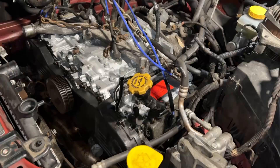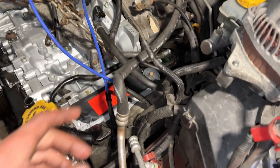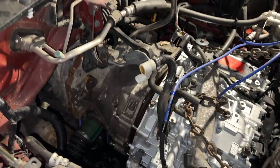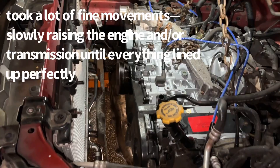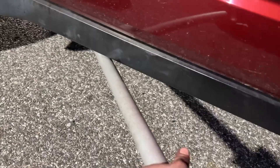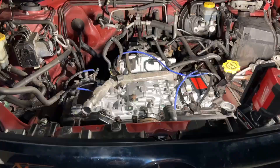The new engine has landed in as you saw by the time lapse, but is still being supported. We're getting the bell housing bolts in the back — had to crawl underneath. Got one in down there and one up top. It took a big fight but we finally got the engine lined up with the motor mounts. The threads are through the holes in the cross member, so I can take pressure off. The whole car sank down but didn't collapse. All the bell housing bolts are now in and being torqued down.